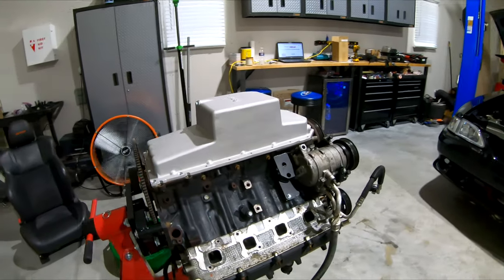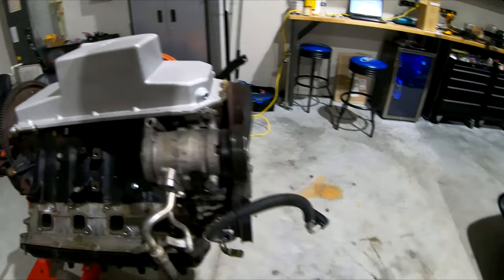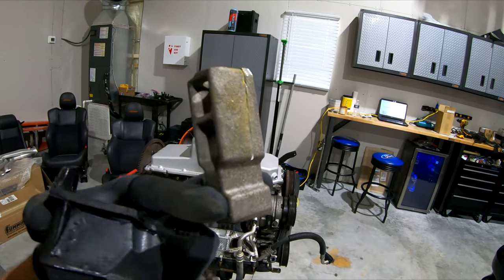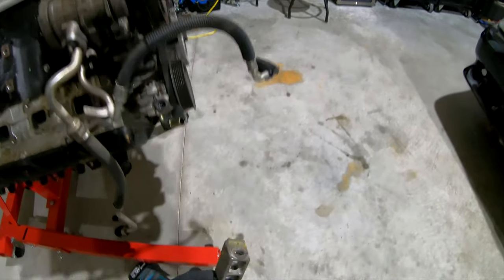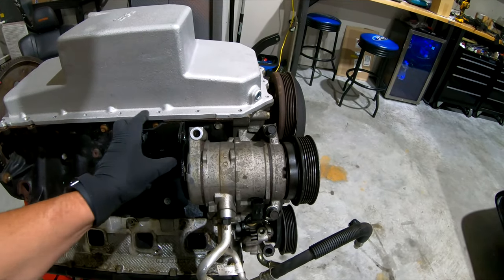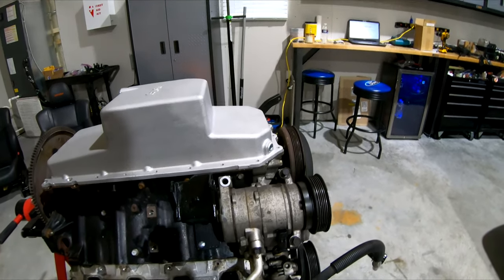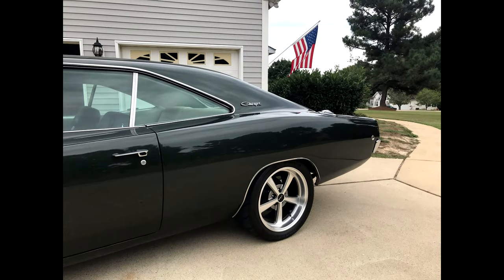You can make an 03 to 08 work — you just got to cut this part of the compressor off. I didn't see it was enough at first, so I cut a little bit deeper and that's what it looks like. You can see it's just hollow — it's just support, it doesn't affect the compressor at all. So we should be good now. Put this back in here like so, and when we drop it in the car it should go in together and be ready to go. Did you mean the Charger? Because, you know, that's got a Hemi too.